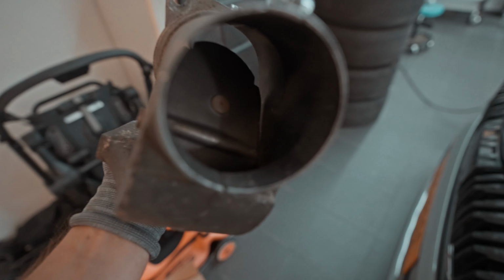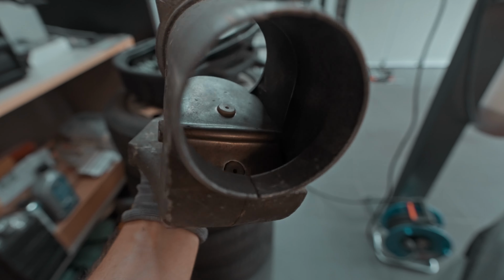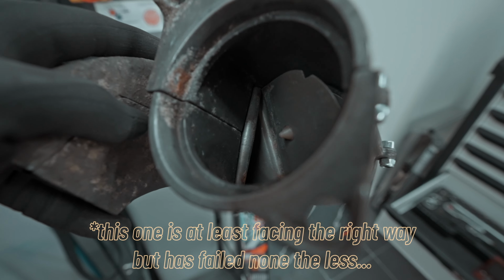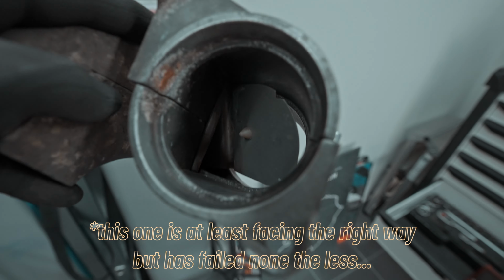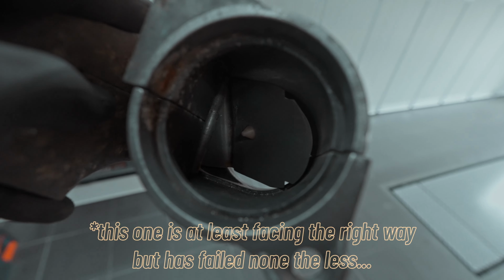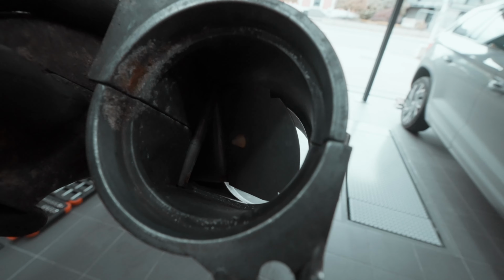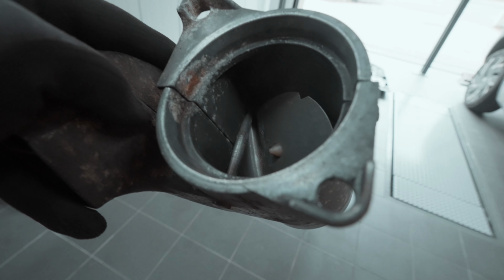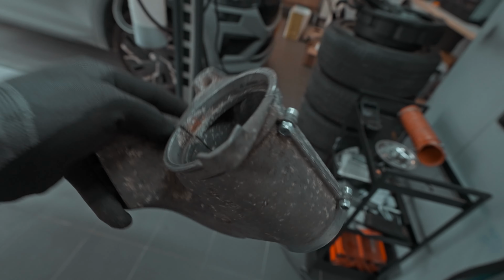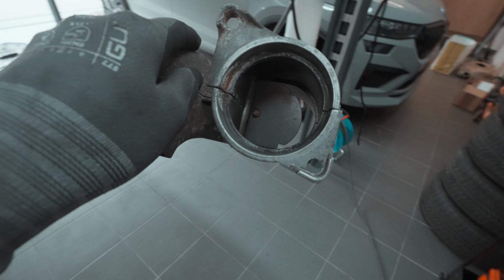And this is the second one, and here you can clearly see that the flap is no longer attached. Depending on how the flap is blocked because of the vibrations and the up and down movements of the car, this can be in a position where it sends the air into the cabin. This is what's making the AC having to work harder. This is going to come out, and I will compare both side to side.